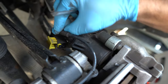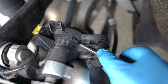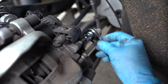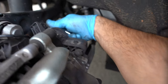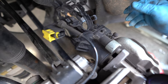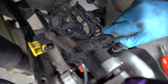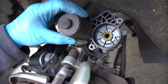Unscrew the ABS wire and move it aside. As you can see, the parking brake has these clips, so the back cover needs to be undone so you can easily access the bolts. The back end comes out and you kind of want to slide it away from the brake. Next, grab your 5/16 and undo this allen bolt — and there's another one right across from it on the inside; it's better to use an extension for that one. Then separate the parking brake by simply pushing it outwards and it should slide out. There you go — take it out and set it aside.